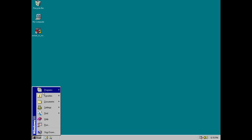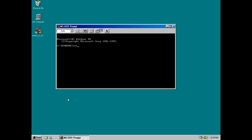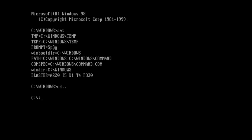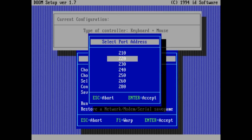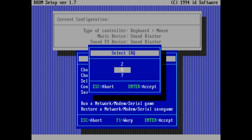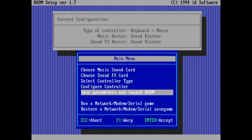Under Windows, you get the benefit of using the ES-FM in native mode, and here it's actually more feature-rich than a Yamaha OPL3, so if you enjoy listening to MIDI files with FM under Windows, this sound card might be something for you. When you launch an MS-DOS prompt, you do get Sound Blaster emulation. I didn't fully investigate that and look for compatibility because we're going to shut down the computer into proper MS-DOS mode, and this is really where the sound card shines.